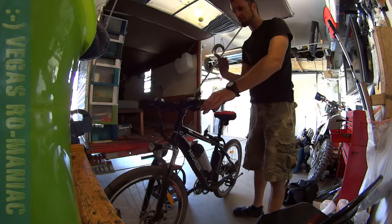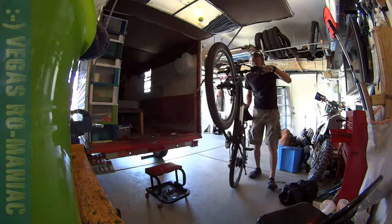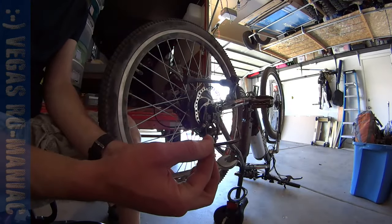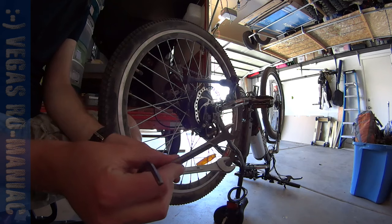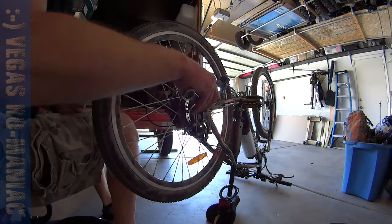Because it's a heavy bike, the easiest way to flip it is to hold the rear brake and just go over the head. Tools required: you're going to need a number 3 Allen wrench, a number 10 wrench, and a number 18 wrench. Take the rear wheel off.